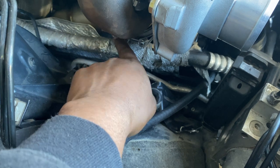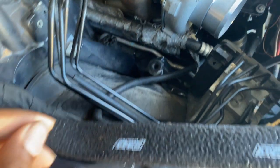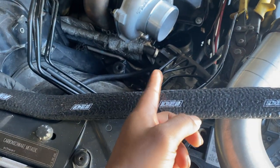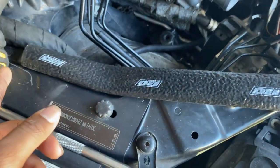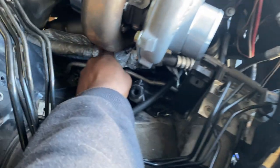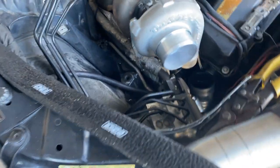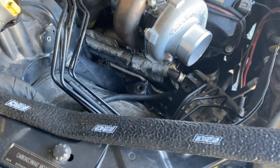Lifted up the AC line and removed it so now I have room to adjust it the way I want. I'm going to cut this insulation in half — I use this for the oil drain — cut about this much, measure it out to cover the needed length, wrap it around, zip tie it down, and wrap another piece over it so it's completely protected from all that heat.